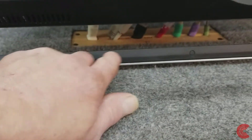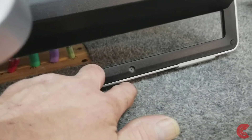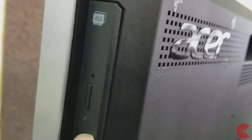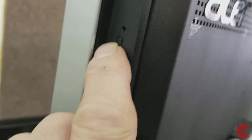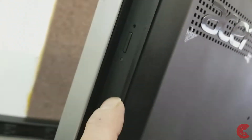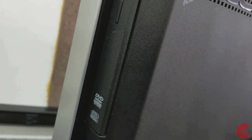There's one, two, three, four — this one's already out — and five. So that's really all the screws. Now on the side here, we're going to pop open the CD tray with our little release using a paper clip or whatever. Get that out. We have to remove that face plate, get that out of the way, and then push the tray all the way back in.